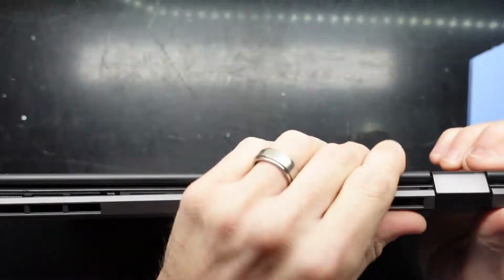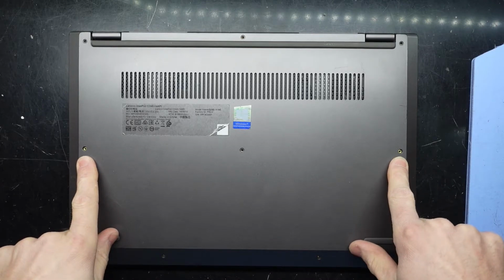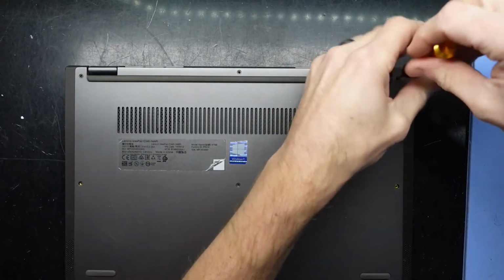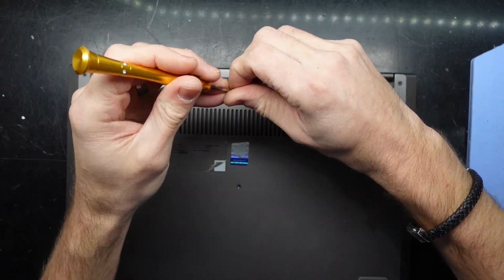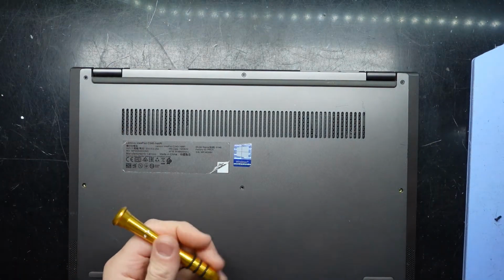Should line up. Click on. And then we can proceed. Looking here, the plastic on this one's actually broken off, as you can see the gold barb. So proceed to put them in the most critical spots first, hinges. All these T4 screws are the same length, so you can just put them back wherever they can go. If you are missing some, as I said, do prioritise the corners and probably the middle from there.